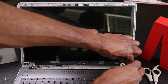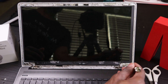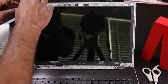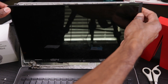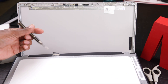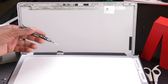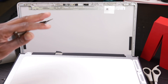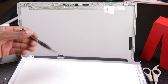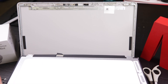This is my first ever laptop screen fix. I got all my screws out, so now if I take my finger I should be able to pull this LCD forward — and we can. Underneath your LCD there's always going to be a connector. This connector pin right here is very important — do not destroy this pin. If you destroy it, you've pretty much lost use of your laptop LCD. So be very careful when you pull this thing out. Always know there's going to be a connector pin that you'll want to release from the broken LCD so you can plug it into the new one.